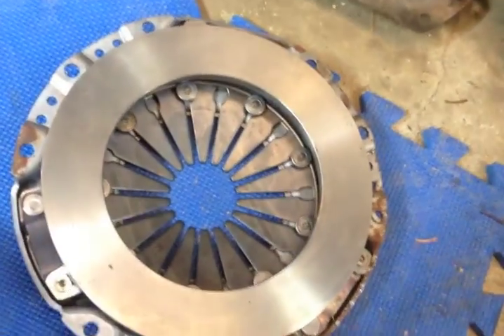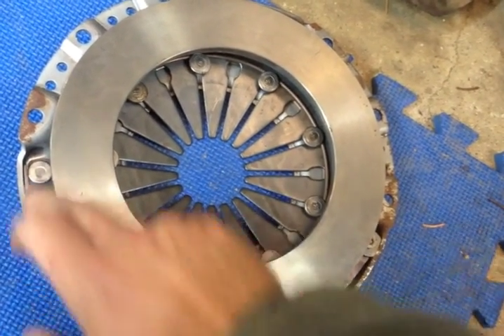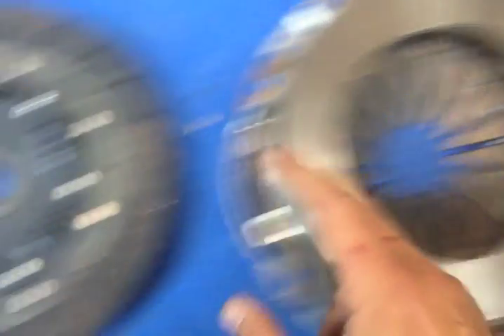If I can't do that, I'm going to have to order a different clutch cover, but I'll still need to hunt one down that fits both the flywheel and this clutch. So the plan is to make a custom adapter plate that replaces the spacer ring already on the engine, except thinner. Exactly how much thinner I still have to figure out — I need to do some careful measuring. Look for me machining an adapter plate in the hopefully not-so-distant future. Take care.